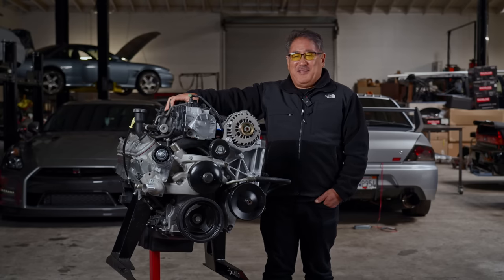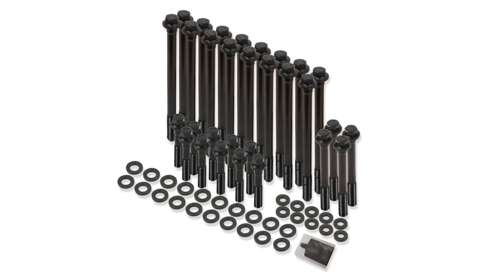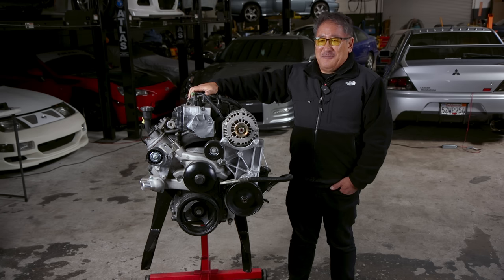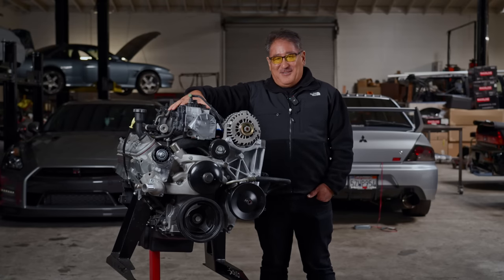When the engine was going back together, the head bolts were replaced with Holley's replacement head bolts. These are not torque-to-yield, so you can just set them with torque — it's a little easier. If you're a first-time engine builder you can use these, set the torque, forget it. Since this isn't a performance engine, those are a fine, easier-to-use alternative.